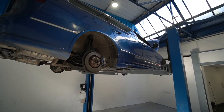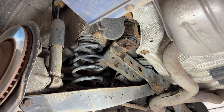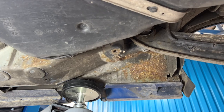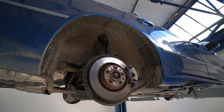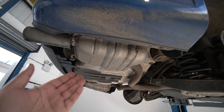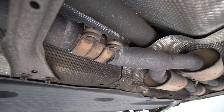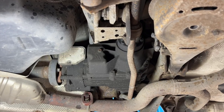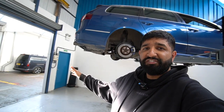Before we begin tearing this apart, let's have a quick walk-around and re-familiarise ourselves because we might have missed some stuff. The main topic for today is to drop the rear subframe — you can see straight away there's quite a bit of rust on there. On the sill I notice quite a bit from prior inspections, it's on both sides, so something's likely going on behind that side skirt and maybe even that carpet arch liner. The exhaust doesn't actually look too bad — less rust than the subframe. Hopefully that clamp doesn't need cutting off. We've also got to remember there's a prop shaft above the exhaust because this car has a Haldex system, so that's going to come off with the whole assembly.